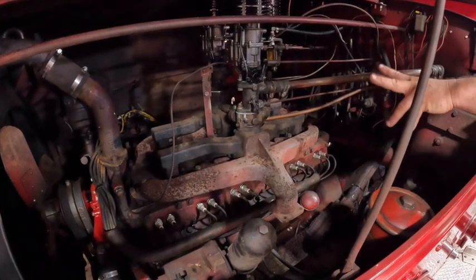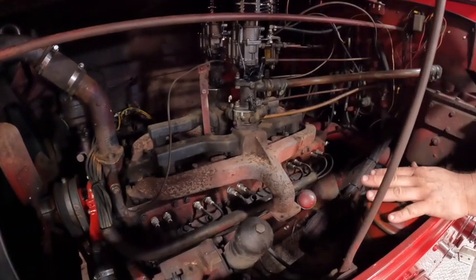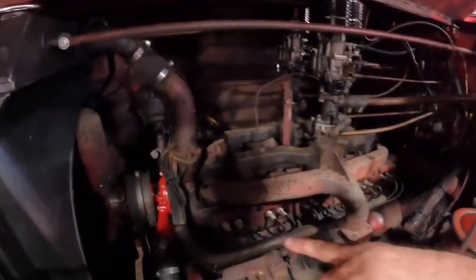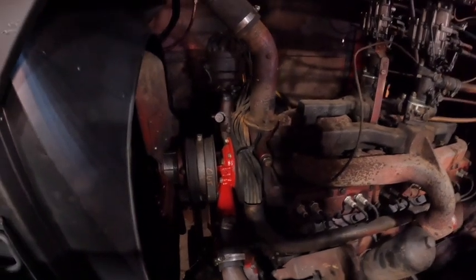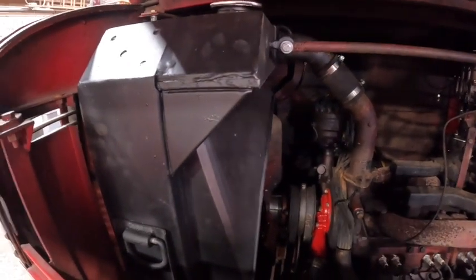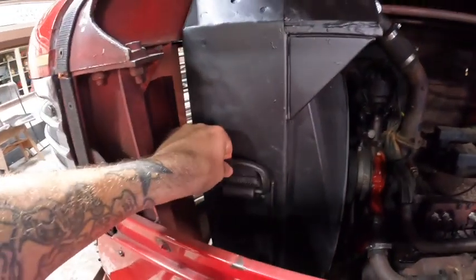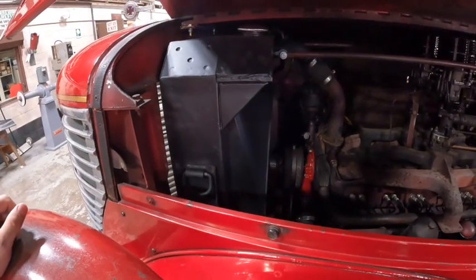It's dual carburetors - dual one-barrel carburetors. We had these all redone. We did up the air cleaners. Had a water pump done over here - swapped that out, it was leaking like a sieve, that's all fixed right. And we had a brand new radiator put in here - sent that out, had it redone, came out really nice. BGR Radiators in Plainfield, Connecticut got that done for us and did a fantastic job.